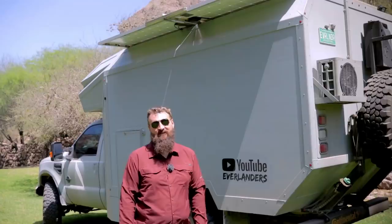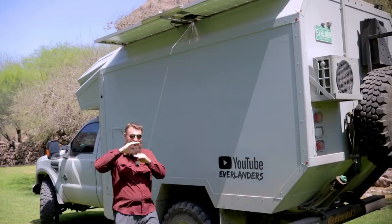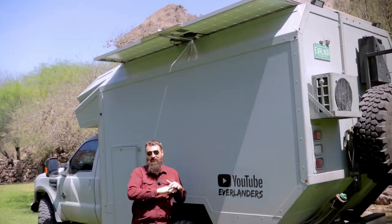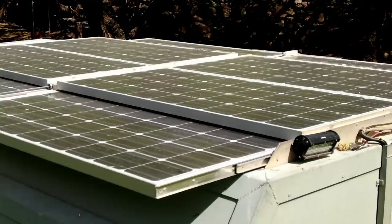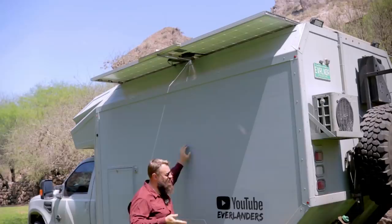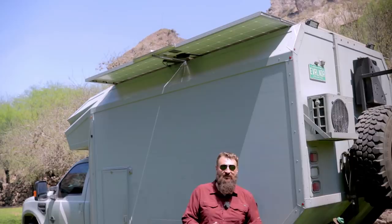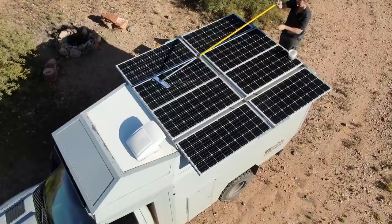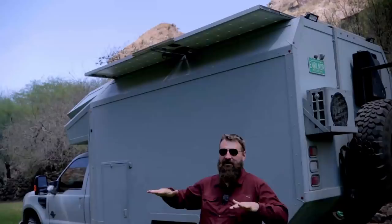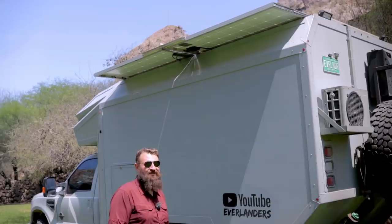Another thing that plays into efficiency is our solar panels. The top set is about four inches up from the roof surface, allowing good ventilation underneath so heat that builds up on the panel can radiate off. The lower set of panels extends outward from underneath and provides shade to the side of our vehicle, so the side doesn't heat up. That's a big thing — if you can keep heat from getting into your living space, that's a big help. That's also a big reason I've chosen framed glass solar panels over plastic adhesive stick-on ones, because those absorb heat and transfer it right into the body of your vehicle and then radiantly into the interior.